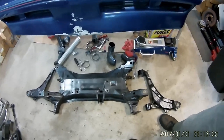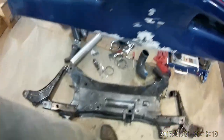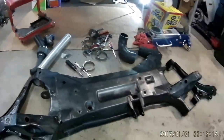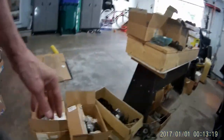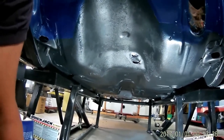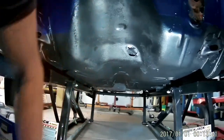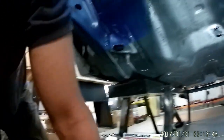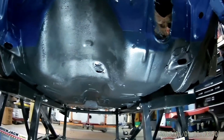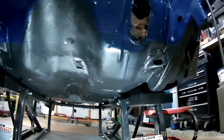The K-Frame has been powder-coated. There are the control arms. One of the things I'm going to do is probably raptor coat this — it's got a few rust spots and a few years of use since it got powder-coated. One of the things we did under the car was remove all the factory undercoating and respray it with Raptor 2K hardener bed liner. This stuff is really strong — you can't hardly scratch it. It really cleans up the look on the bottom of the car and it's going to do way more than the rust proofing did. The rust proofing just got onto everything; you touched it and it was all over, and it didn't really protect the car that well.